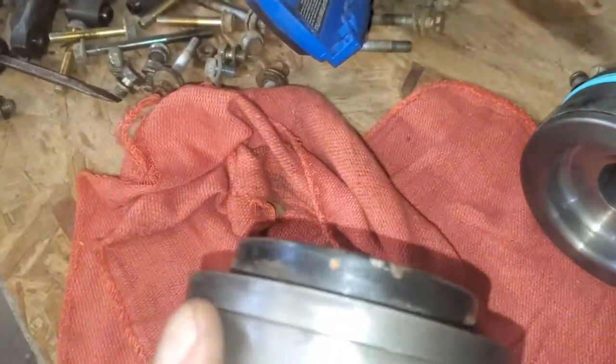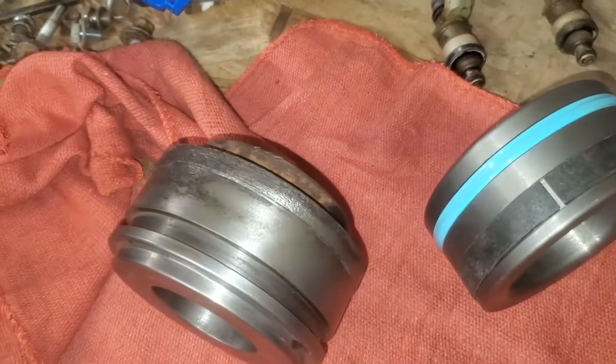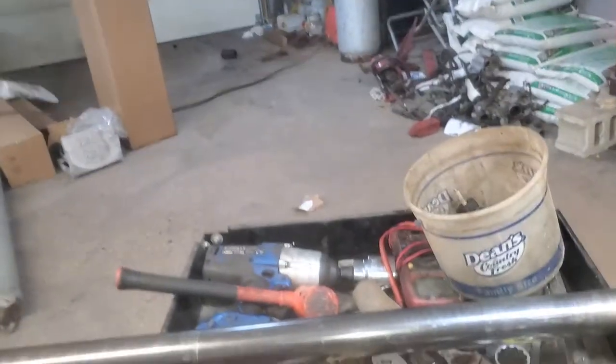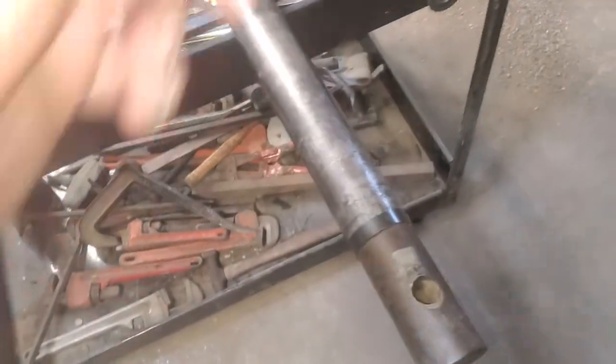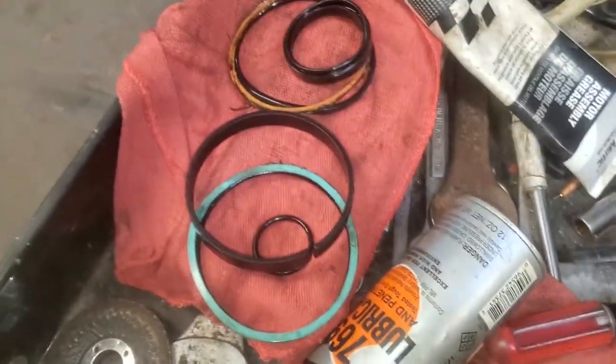This one slides up and down the shaft and this one gets bolted to the back — there's that o-ring on the threaded shaft. That's all there is to it. The hardest part is getting them back on because they're tight. One guy suggested putting them in hot water and letting them expand a little bit, which might help. Also, some shafts will have another snap ring inside after you take off the first outer snap ring, so you've got to check. Some guys have pulled and pulled and ripped their heads right off trying to get it out because the other snap ring was still holding.